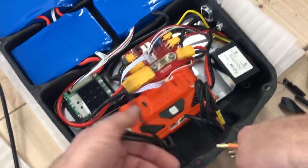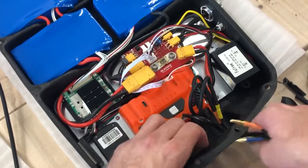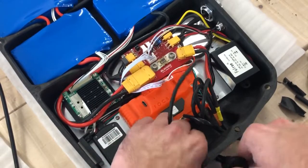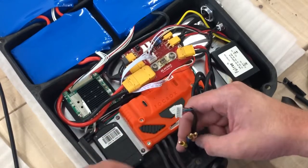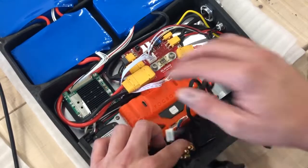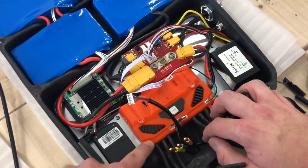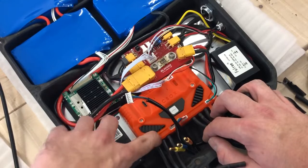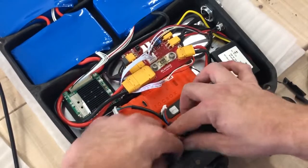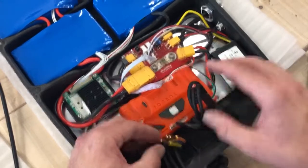This is how you put those on the motors. Once you go back and connect the motors — as you can see, the last step I do is to push this little clip back. For the wiring order — and this is one of the important things in this video — the first motor is blue, orange, yellow, and on the other side it's reversed: yellow, orange, blue. To repeat: it's blue, orange, yellow on one side and yellow, orange, blue on the other. Once all six phases are plugged in place, you can plug the two sensor cables back.